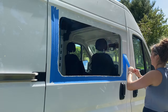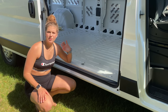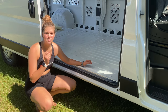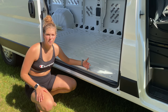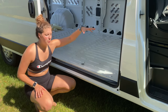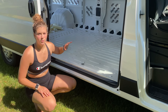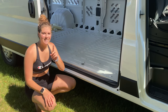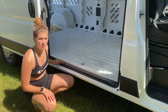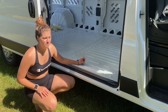While that was drying, I took off the painter's tape and cleaned the entire van free of metal shavings. Make sure once you're done cutting and drilling that you do your very best to clean up those little metal shavings because even the tiniest one will cause rust. I used a broom, a vacuum, and a microfiber cloth with all-purpose cleaner. Don't just clean right by the door — shards can fly in other directions as your van vibrates when cutting, so go through the entire van. One spot I missed had small rust starting to form on the inside when the sliding door is open, so make sure you clean thoroughly in that crack so no rust forms down the road.